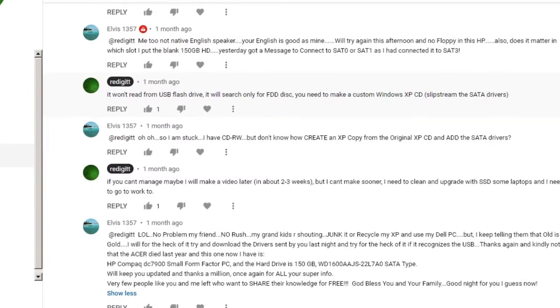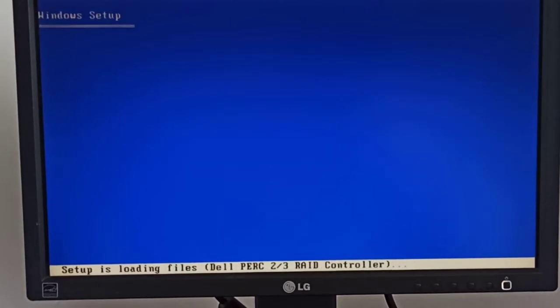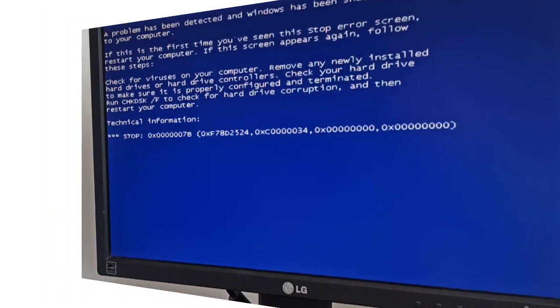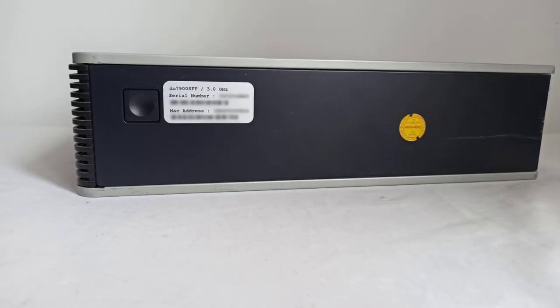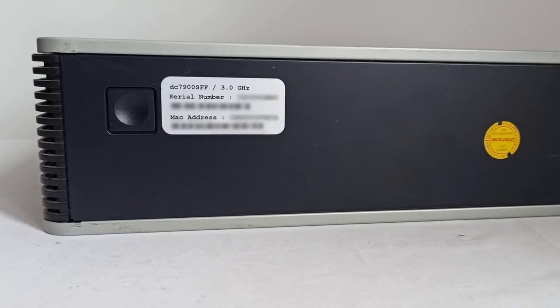This video was requested by Elvis1357. He keeps getting the blue screen when he tries to install Windows XP on the HP Compaq DC7900 PC. The blue screen appears because the Windows XP installation disk doesn't contain the SATA drivers and doesn't recognize the HDD. I managed to borrow this refurbished HP Compaq DC7900 small form factor PC and I will show how to integrate the SATA drivers to the Windows XP installation